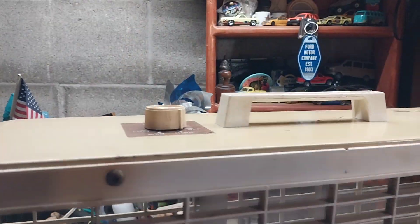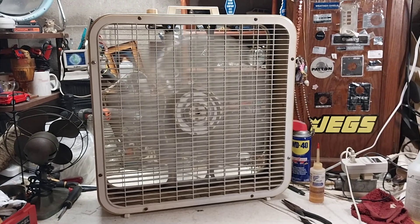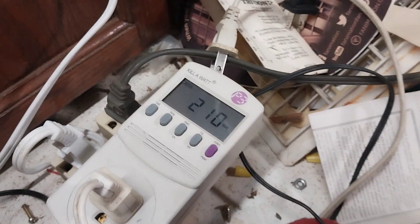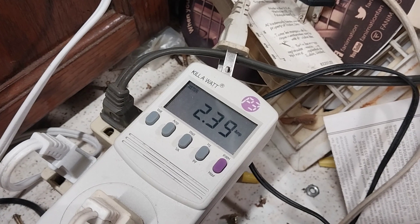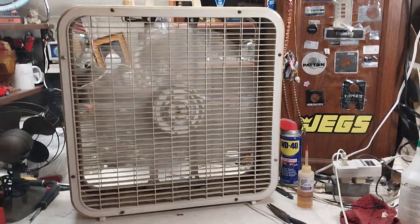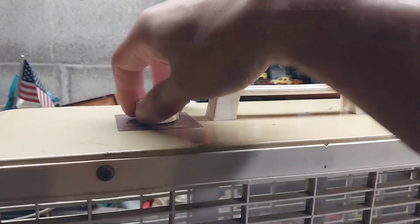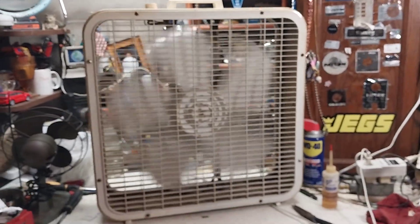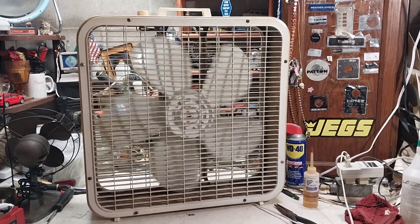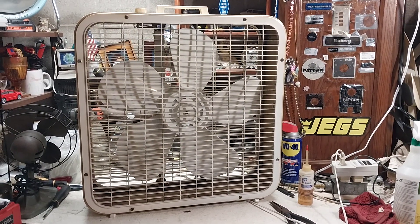Back to high to see if it's gone down — yeah, a little bit, it's going down slowly. Now it's at 2.3 amps. Seems like once the motors warm up after a while, the amp draw goes down. And here's off. So yeah, there's the second-gen Lakewood JC Penney model 9700 box fan — one of the many rebadges that Lakewood used. Thank you for watching and I hope you enjoyed.